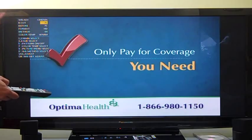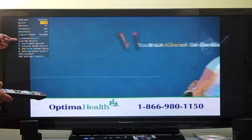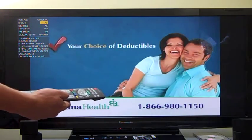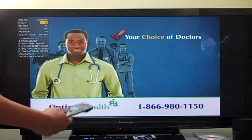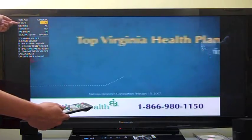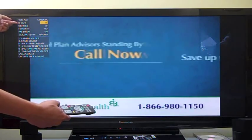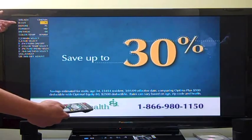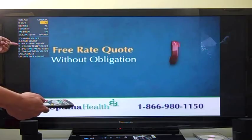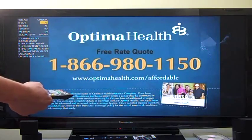We've already covered keys one and two for the main menus. But to stay within the White Balance Adjust and move around the sub-items, use keys three and four on your remote. If I hit three, we go from R cut (red cut) to green cut to blue cut. If you hit four, you go back. Key five changes the pattern on or off — it selects the test pattern and then you can turn it off to go back to the source video.